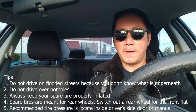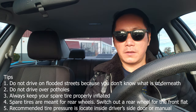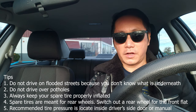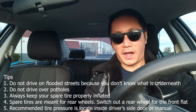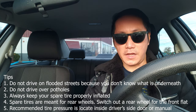The reason I made this video is to let you know what to do if you have a flat tire and the spare also goes flat. Here are some quick tips: make sure you check the air pressure of your spare tire annually. An undersized spare tire is not designed to be driven on the front, especially for front-wheel drive cars, because it's top-heavy and combined with the transmission and steering, you want a full-size tire — using an undersized spare up front can damage your axle and alignment.